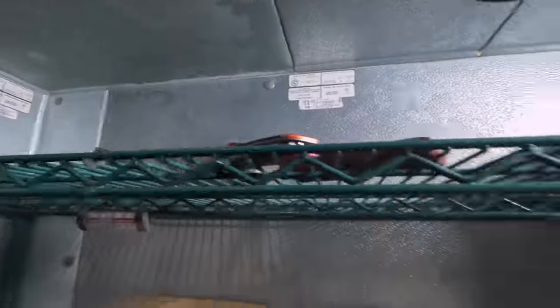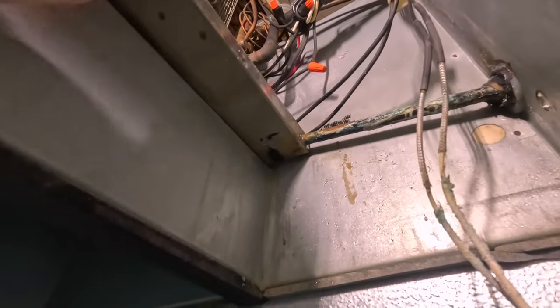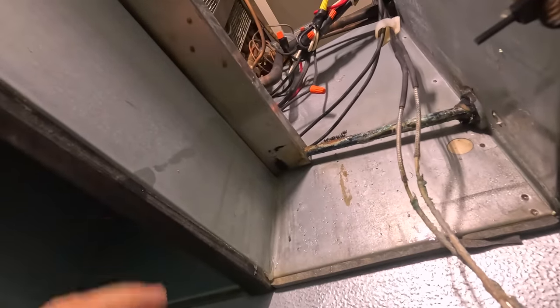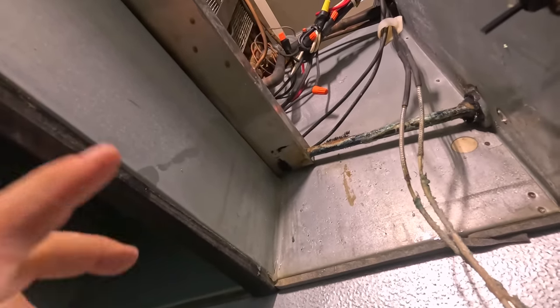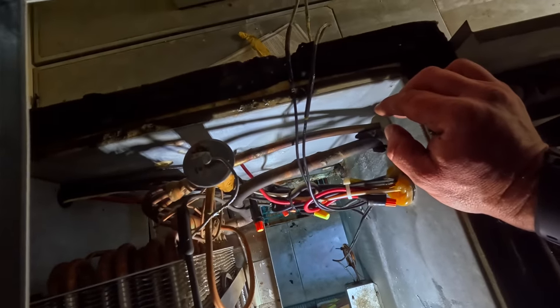I think they just jammed a piece of copper into the stainless — yep, that's what it is. A piece of copper jammed into the stainless, nobody soldered it. That'll do it. Somebody half-baked it. So we need to get some silver solder and solder that thing in there. All we're doing now is making water in the freezer so it can freeze. They didn't braze it, didn't glue it, didn't silicone it, didn't do anything. I've got to try to dry that out, flux it up really good. It's flared, so that was like that from the factory. What we're going to attempt to do is flux it up really good, put most of the heat on the copper, then push it over to the stainless and don't move it while it hardens — and hopefully we'll have a good braze.